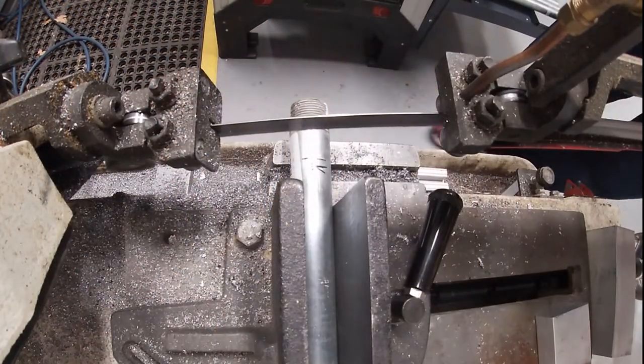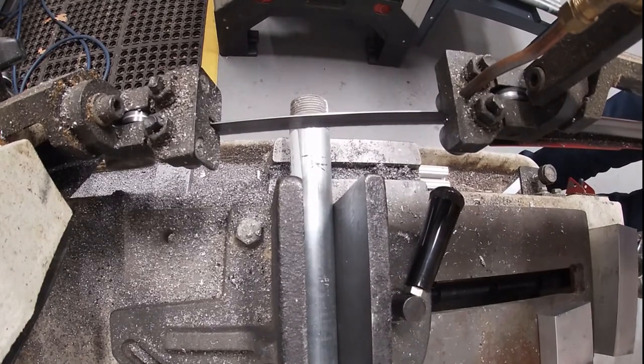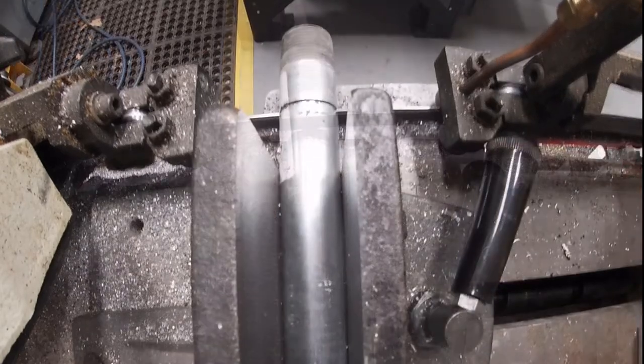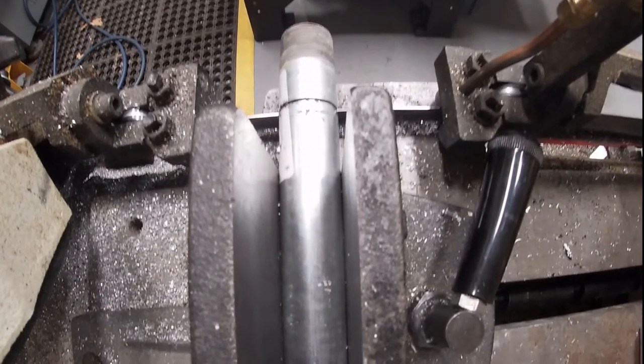None of the prefabricated bunk supports were high enough for what we needed, so I fabricated some out of zinc-plated tube stock. They're basically just a 2-foot length of pipe with a hole drilled in one end to mount a pair of brackets that connect the upright to the bunk itself.